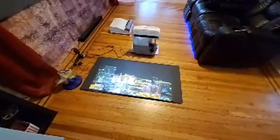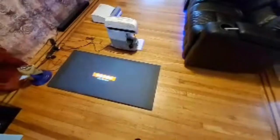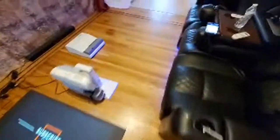It'll do that on any screen, any light gray screen, any silver screen, any gunmetal screen. If you push that contrast level all the way back, it causes the screen to have a real dirty look to it. Try it out for yourself. Go home, if you have a projector, and go to your settings and push your contrast level all the way back down to the bare minimum, and then do the same thing with the brightness.